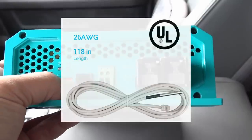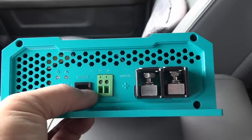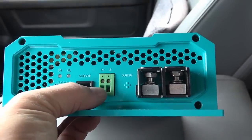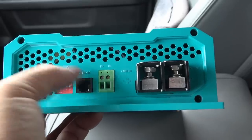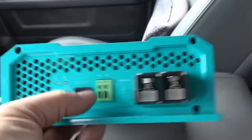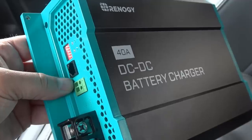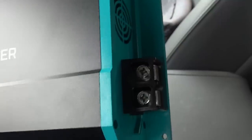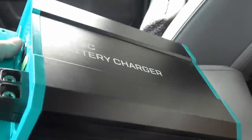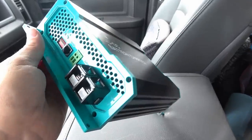There's a plug-in for a temperature compensation sensor — if you have lead acid batteries in the cold they need a higher charge rate, but I won't need that for lithium. There's a trigger wire so you can turn this on and off, and then there's what they call a current limiter — the manual says you can limit the output to 50%, though I'm not really sure why you'd need that. I'm going to use my running lights to trigger this on and off.